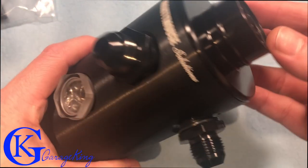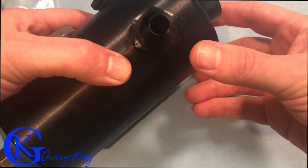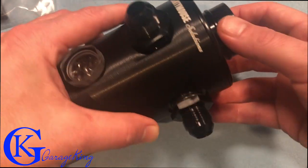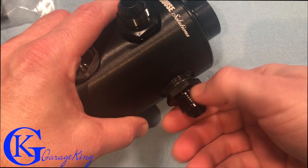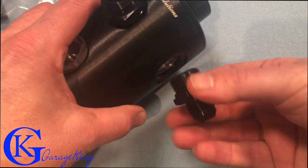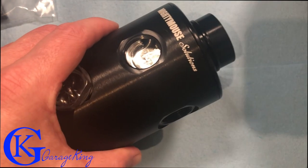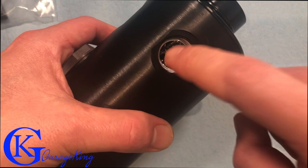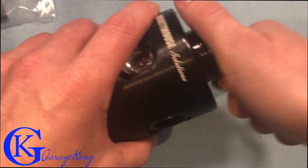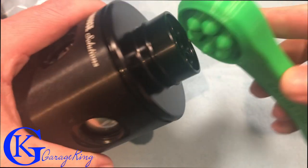All right, nice close shot of it. So now you can really see — we're going to get up nice and close. There's our drain, sight glass, and you have the two ports. One's an inlet and one is actually an exit. Now that I've screwed this in a little bit like I showed you, I can actually take out these fittings here — we're going to take out the ports. These are AN8 fittings. There we go. And now you can see there's the entry where it's full of stainless steel mesh, and there's the outlet. It didn't need much tightening, so I can undo this with my hand. And it actually does work really, really well.